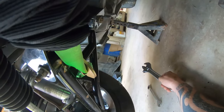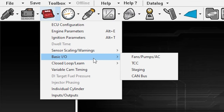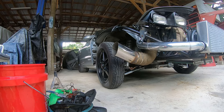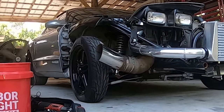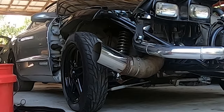WD-40 just vaporized everywhere. Now we're going to get into the bump button. I got it wired up the way I thought was correct but something's not jiving. I got the staging set up with the pulse method and the Holley Terminator X set to 0.019 seconds — in the middle — and it still ain't working. Basically what I've got going on is I let off the trans brake button and push back on it real quick. I'm thinking about just wiring up a relay so the bump button can do that for me instead of having to let go and grab.